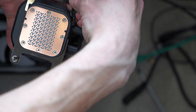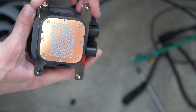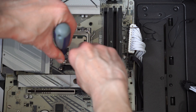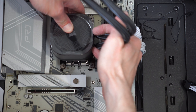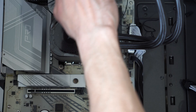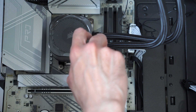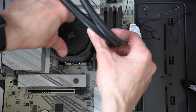What about the Corsair all-in-one cooler, the RX Titan? It comes with Intel brackets by default, so you may need to switch to AMD brackets. You keep the stock backplate but remove the standard plastic brackets, then mount the all-in-one cooler directly — there are no other fiddly brackets because they live on the cooler head itself. You screw it in, make sure it's tight, and put the cap on.